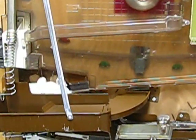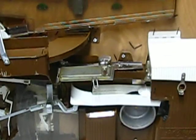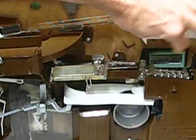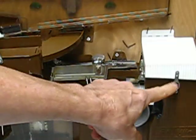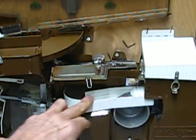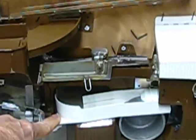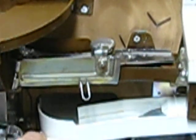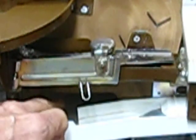And there it worked — you can see all the mechanisms are working just fine. The balls are coming out of here, the winning balls are in the hold area to be released for the payout. They come down through the chamber, drop on this ramp, and as they do, they hit this bell here — that's the noise you heard. Then they flow down this ramp and forward to the payout tray in the front of the machine. They come through with this lever, hit this bell, and then go to the payout tray.